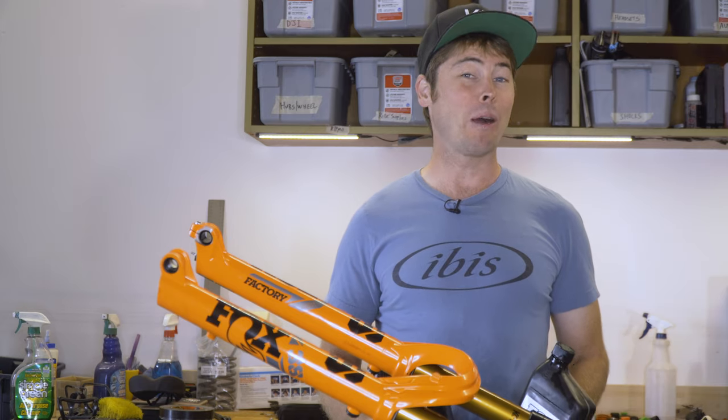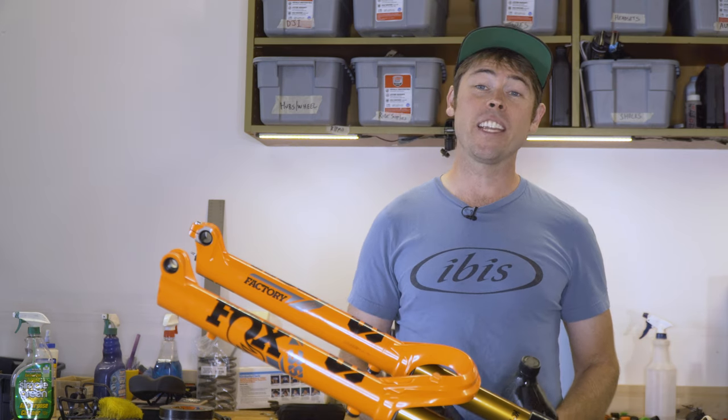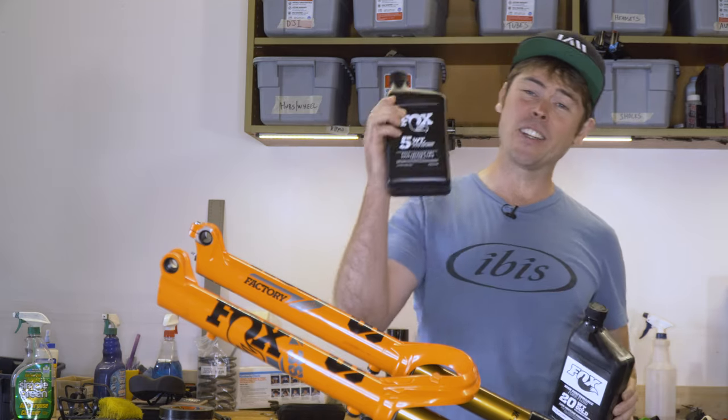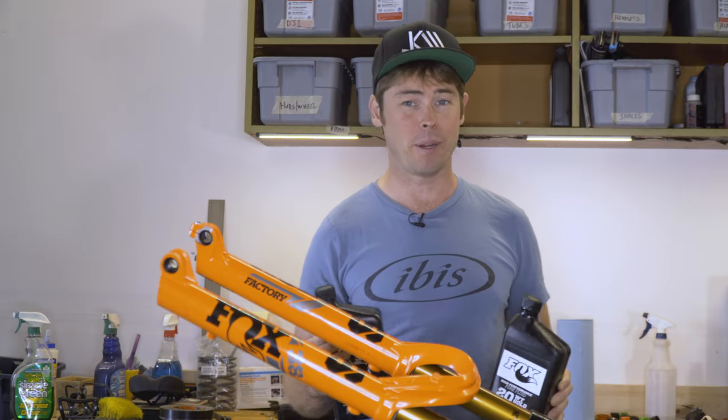As you all let me know in the comments down below, I made a mistake in the original video, so I'm reposting this now. You're gonna need to use two different types of oil for this rebuild. You're gonna need to use Fox 20 weight gold oil in several places, and you're gonna need to use the 5 weight Teflon infused oil for the grip damper. We're also gonna need maybe a 10 mil, 12 mil, 15 mil socket, a few things like that.